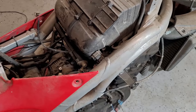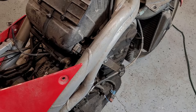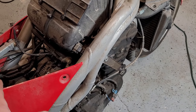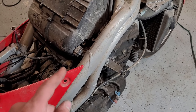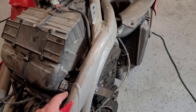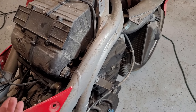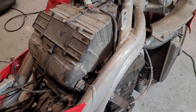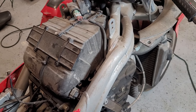As I'm looking at this, I believe these are coil-on-plug. So the spark is actually controlled by the ECM — or ECU, whatever you want to call it. I don't think any of the stator or charging system issues should affect spark, so I'm not entirely sure why all that was done. Maybe I'm misunderstanding how the system works. I think we should pull the air box out of the way so we can get to the coils, pop them out, and check for spark.